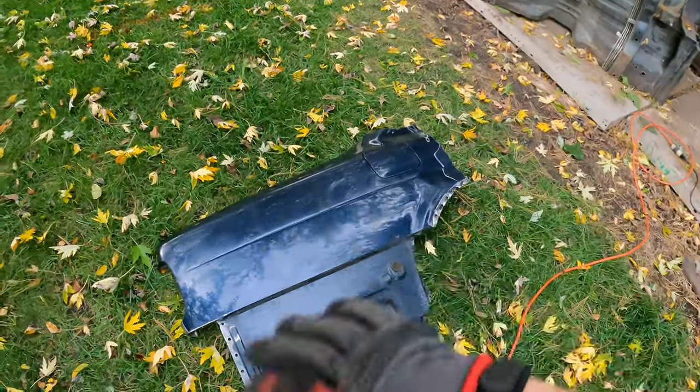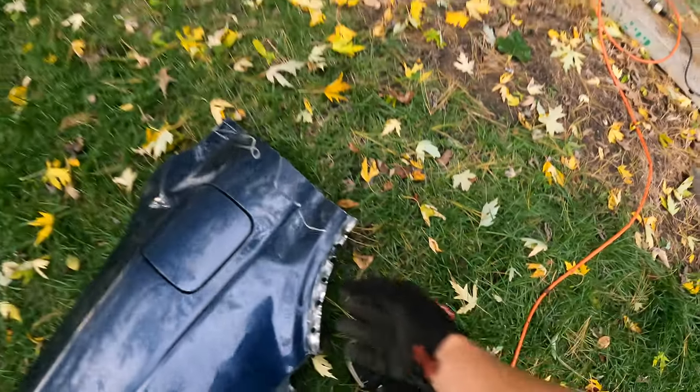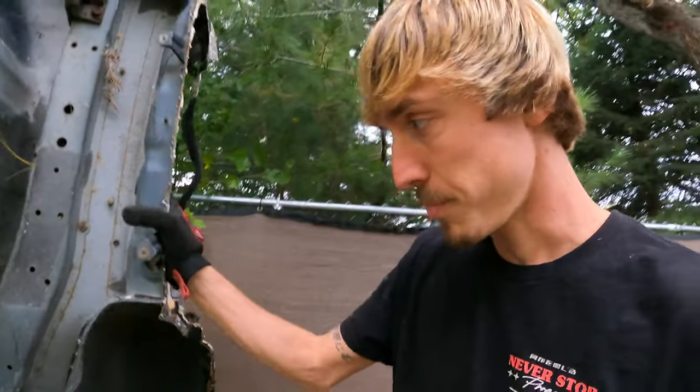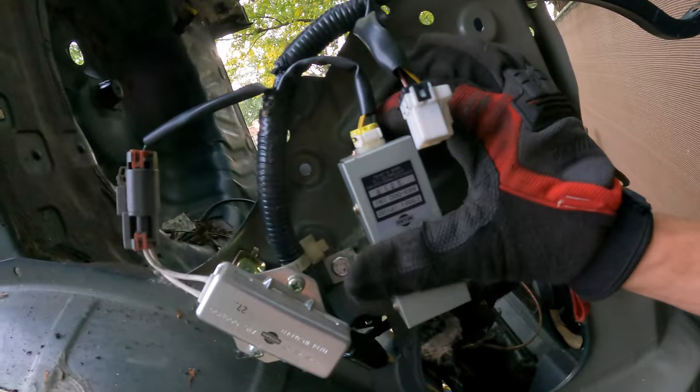Another piece — though not to the puzzle. This is basically going to be a jig in case my quarter panel doesn't come in time when it's time to weld up the car. Luckily this area is straight enough to line up the bottom of the floorboard, the taillight section, the C-pillar, and the wheel arch — all the main major pieces. I already drilled out the spot welds along the wheel well and these attach to the floorboard. I'm pretty sure I have all the spot welds drilled out on the bottom of the car.